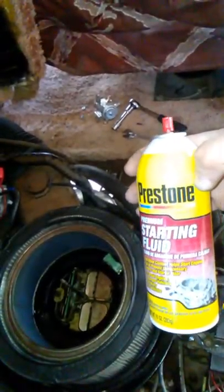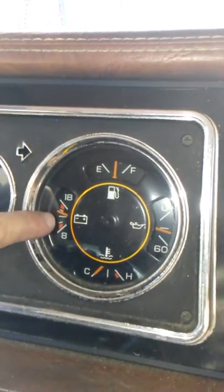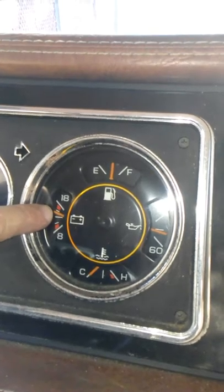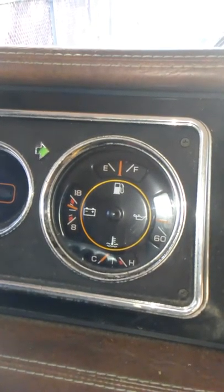I had to keep my foot on the gas a little bit and use some good old-fashioned starter fluid — not too much, just enough to give it some extra boost. Now if you look, it's hard to see because of the light but you can see it's way above the halfway mark, which is where it's supposed to be — charging at around 13 to 14 volts. I'm going to turn on the headlights to see what happens.